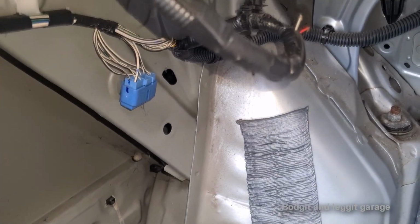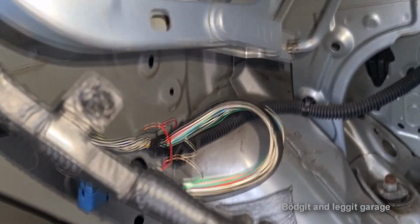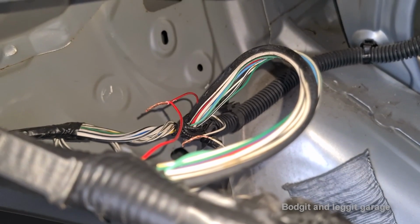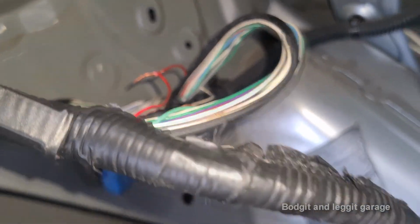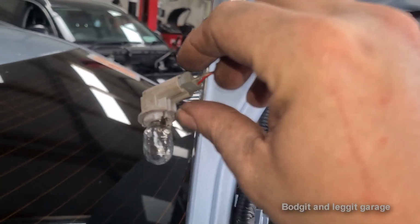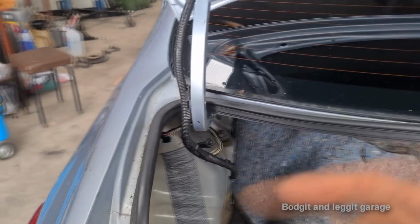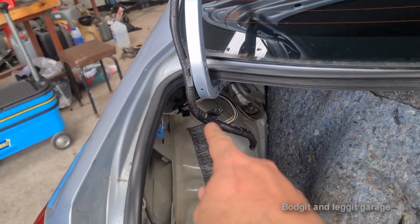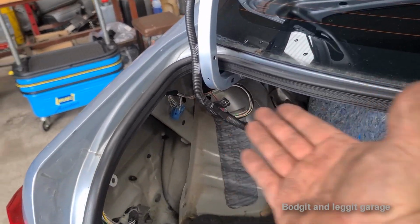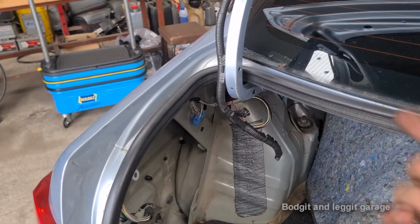When we connect these two with our jumper lead in, that reverse light should work. Right, okay, I've stripped the wires back, and there's a big chunk of them missing, but I've just put them together to test this theory, to see am I right or do we have another issue? Because once you test one thing, which was bad, which was the switch, you just assume everything else is okay, but you can't assume that, because we essentially had two problems here. It doesn't happen a lot, but it just goes to show that it does happen.